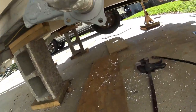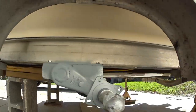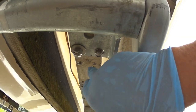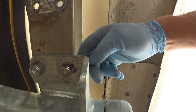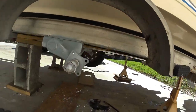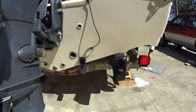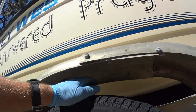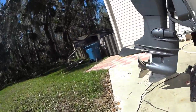Before I forget — I already got the other side on and there's a tire on there. I had to drill a three-eighths inch hole to get it to fit completely on this rail, and a half-inch hole to come off the rail, so everything's fitting nice and tight. My one challenge is going to be when I drop the trailer down — this is already pretty close to the fender right here, which I did not anticipate and cannot easily adjust.